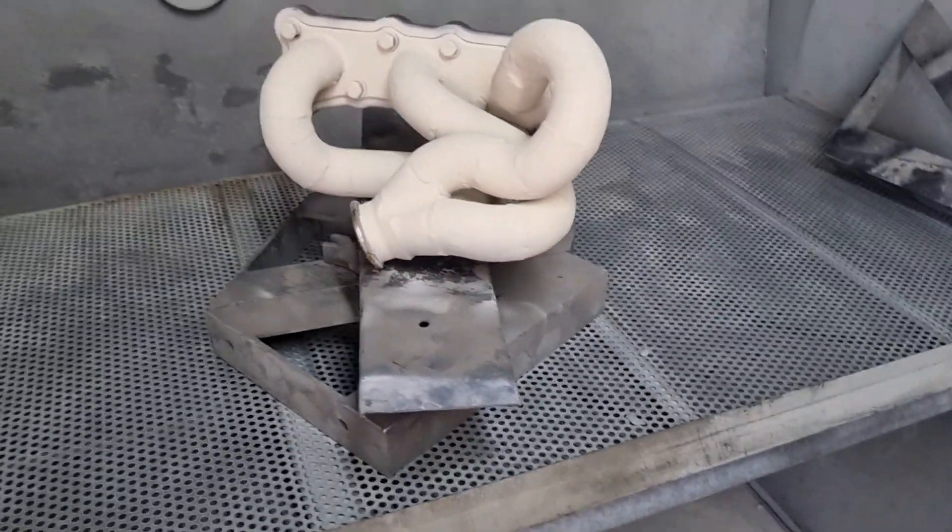At this point we're going to actually get the process done. The final stage on top of this Zirconia — you could use the manifold immediately like that — but what we do, we take it one step further and we coat it with a titanium coat on top of that, which is stain resistant and just adds another layer for more thermal protection. I'll end this part here and then we'll pick up the video when Andronigo is actually adding the coat onto the manifold.